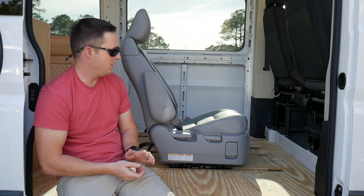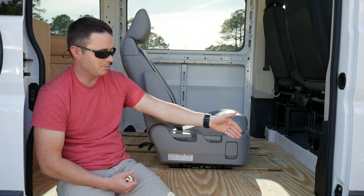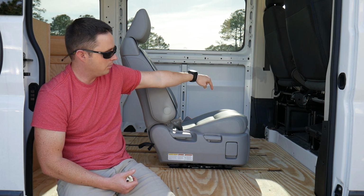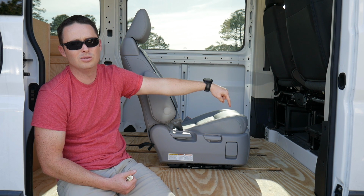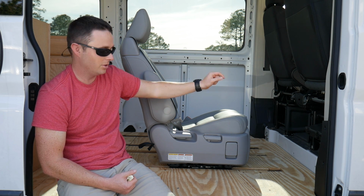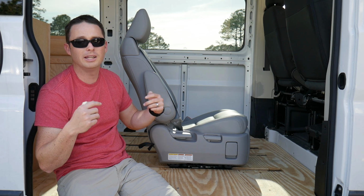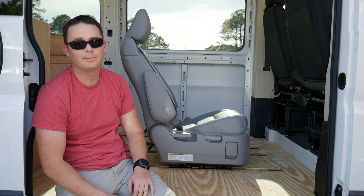We basically made reinforcements that go between the cross members, so they bolt to each one of the cross members, and then they go along each one of the middle of the rows. The front bolts, I don't have a good picture because it's really hard, but they mounted straight into the main cross member up in the front, and we bolted those down. And then the backs, we actually ran a horizontal bar, which would tie in all of them and keep it square so nothing would shift out of alignment and prevent us from using the tracks.